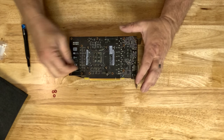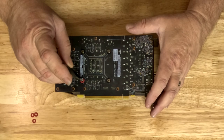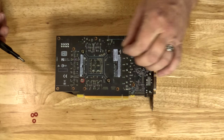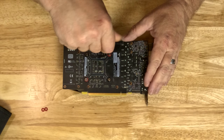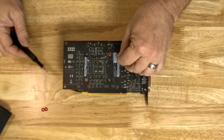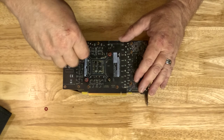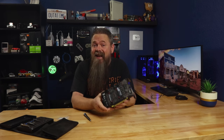The way I like to do this is take one screw off at a time so you retain spring pressure on the GPU itself. It's also a really good idea to repaste the GPU before doing this, because with dry thermal paste you might have an issue. Put the washer in place, then replace the screw into the hole making sure the washer is right underneath it. Repeat this three more times using a cross-hatch pattern to avoid disturbing the thermal paste. This doesn't require removing the entire heatsink — you're only applying washers to the mount behind it.